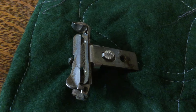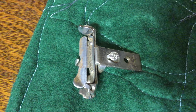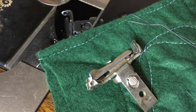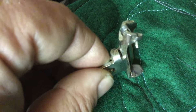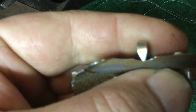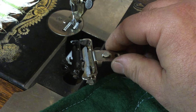In the video on the full size versus three-quarter size, I mentioned the shuttle carrier in my Singer 127 had a spring broken off. Since making that film, I went and dug through my stash of parts and found a carrier from a lot of Singer 128 parts that I had bought. Interestingly, the 127 and the 128 both use the same shuttle and the same carrier, so all I have to do is clean this carrier up a little bit and I can install it in place of the broken one.